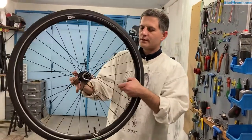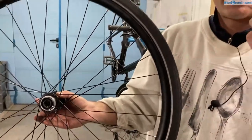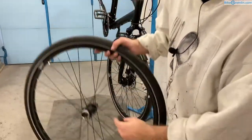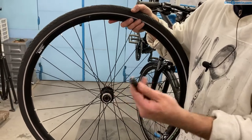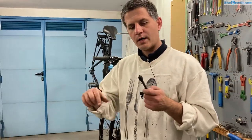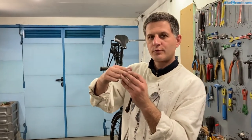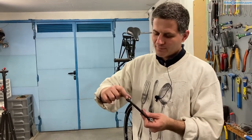Now I will show two ways of removing the dust seals. Some hubs have dust seals on the outside put on the cone — as you screw it in, the dust seal goes in place, and it's a lot easier to do maintenance with those. Some Shimano hubs have seals on both the hub and the cone to create an overlap, but from what I can see it creates more difficulty for maintenance than it prevents dirt intrusion. I prefer those hubs where the dust seal is part of the cone itself — Shimano doesn't seem to make those anymore, unfortunately.